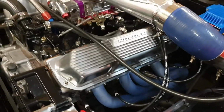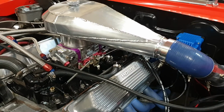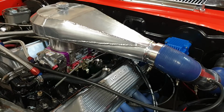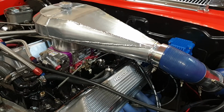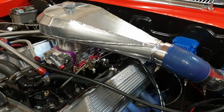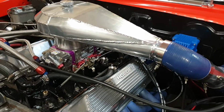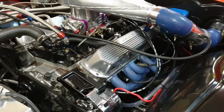Because I know my fueling now is up there. I've got great fueling, maybe a tad rich, mid-range. It'll be very interesting to see now if I can ignite the fuel up top. Fingers crossed, it might clean up the air fuel a little bit up top, which I need to. Then I can address mid-range as we go. But things are very promising now.